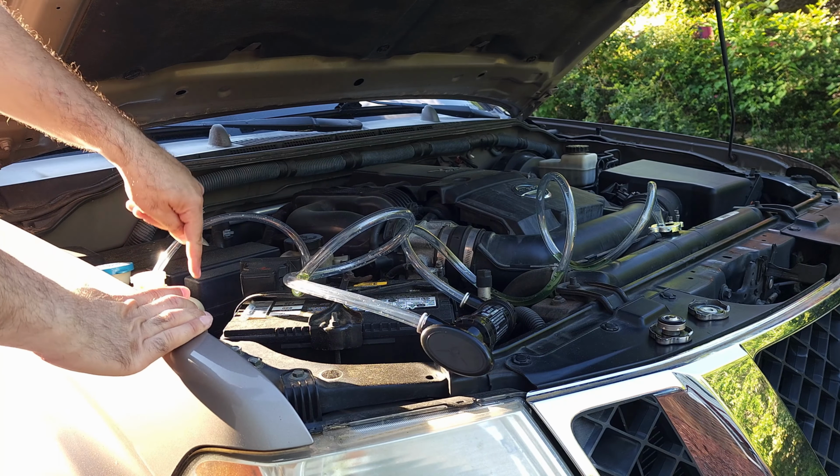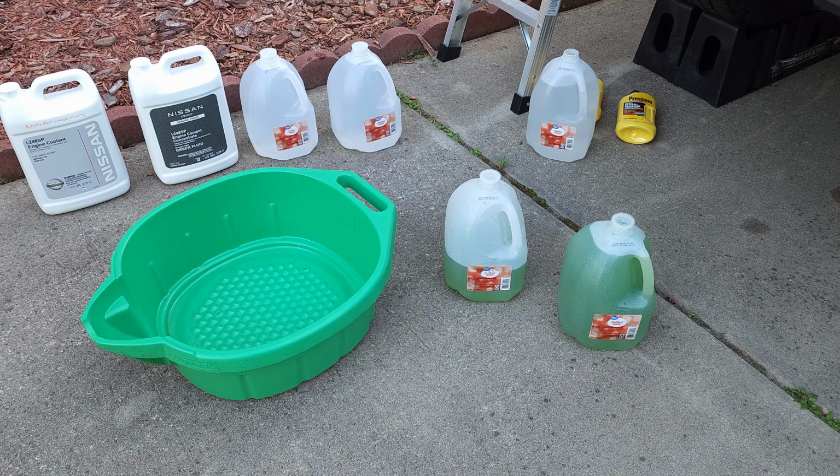So here is my theory. I'm gonna add 1 gallon of concentrate directly into the radiator, and then I'll add 1/2 gallon of distilled water, and we will measure it, see if it works out well. I'll run the car first, have it mixed. Even though it will be maybe low, I'll still run it a little bit, and we'll see when it is up. We'll measure then.